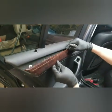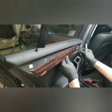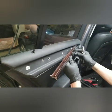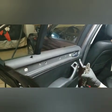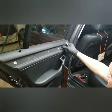So you want to work your fingers down along the end. You don't want to grab it from this end and yank, because you have a greater risk of breaking it. All right, you pull it out of the second holder and then just pull it away from the door handle here. You see the 2 little tangs here that hold it in the inside door release there.